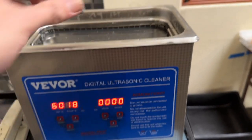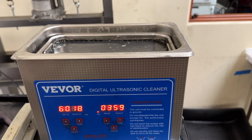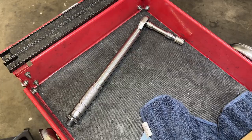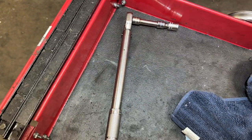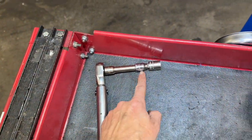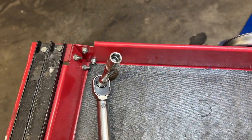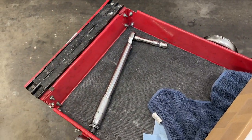For good cleaning measure, take the old bolt and drop it in the ultrasonic cleaner — completely unnecessary, but it gives you a nice clean bolt to work with. To torque the bank one drain plug, a 3/8 torque wrench does fit in there — a little tight, a little awkward. Torque is 18.5 foot-pounds, 25 newton meters. The setup goes: torque wrench, 3-inch 3/8 extension, then a 1-inch wobble extension, followed by a 3/8 13-millimeter socket. With our fresh washer in there, that's torqued back.